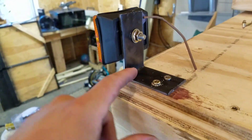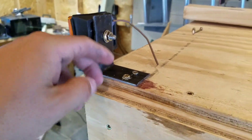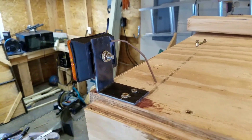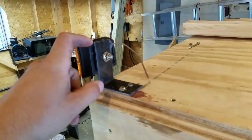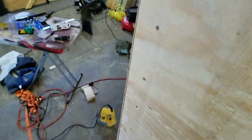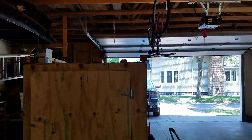I know I need these marker lights, so I took a little piece of — I think this is eighth-inch by inch-and-a-half flat bar — and I bent it. It was five inches; I bent it not quite in half because I wanted it to be a little taller. I put in two screws and this just bolts on there. I think I'm going to have to add a ground from here to the frame, because normally these just ground out to the frame — it has a hot but it needs a ground.